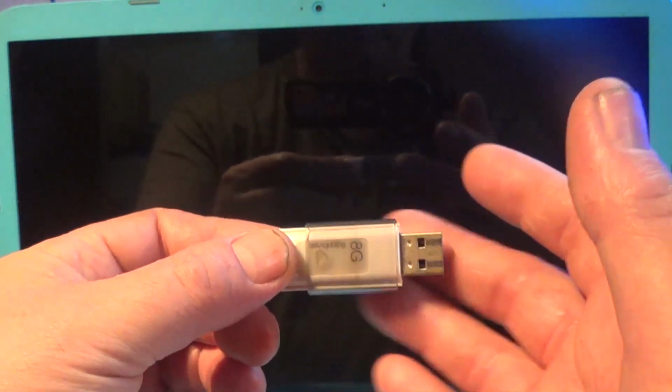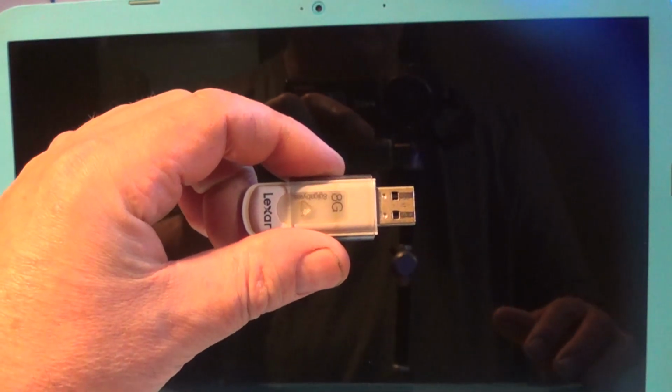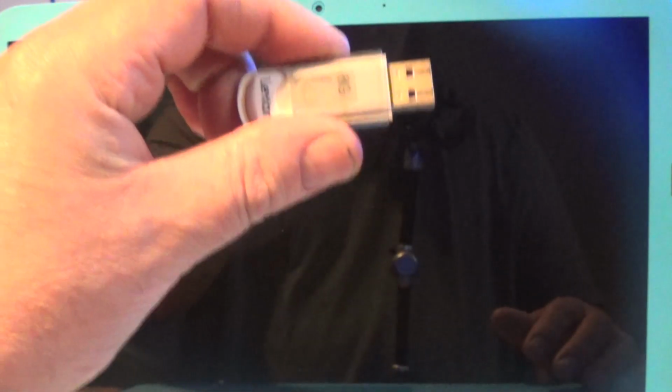But we are going to start by putting the Duet with rEFInd, I keep wanting to say rEFInd first, Duet with rEFInd into the USB 2.0 port, which is the furthest port away from the HDMI port. On a Stream 14, you have 3 USB ports on the side. 2 of them are 3.0, 1 of them is 2.0. So you have a 3.0, a 3.0, a 2.0, moving away from the HDMI. Duet with rEFInd likes USB 2.0, is comfortable in it. So that's where we're going to start. We will plug that into the laptop and we are going to boot.